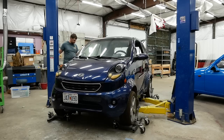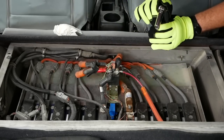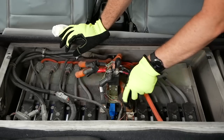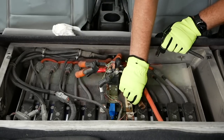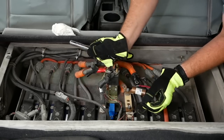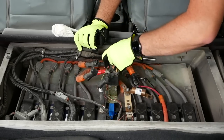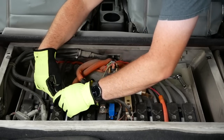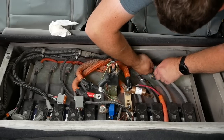Because I've done it before, I'm going to start with the Wego. In the back of the car — if it can even be classified as such — I need to disconnect the high voltage fuse. High voltage is a term I use loosely, because currently the battery pack is reading three volts. Swing that out of the way, disconnect the power from the chargers in the back, disconnect the high voltage leads going to the inverter, disconnect this little nub and go into the main BMS module. Disconnect these connectors, and finally disconnect each one of the nine BMS connectors.